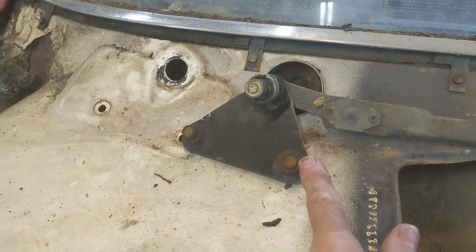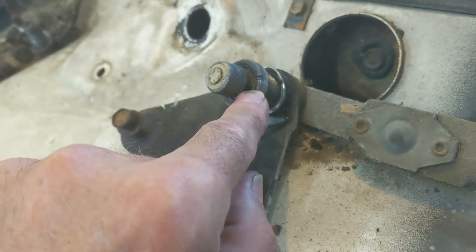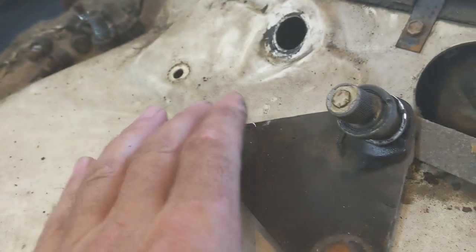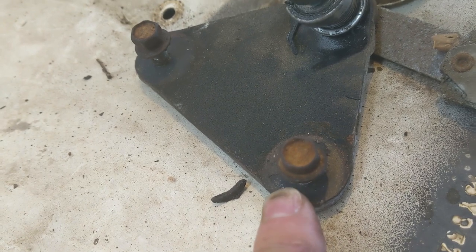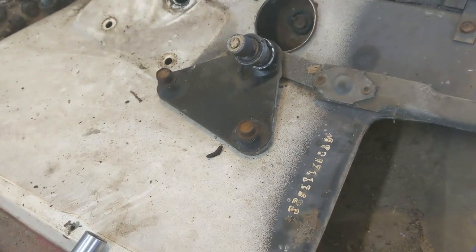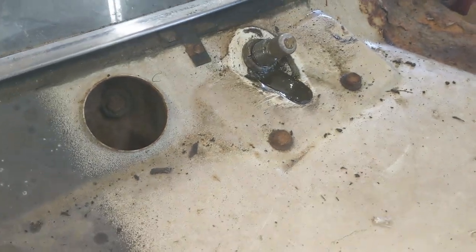There's the right arm off. So there's a chrome-plated or stainless ring — I'm not sure what it is, it's pretty dirty — and then there's the nut with the slots on it. There's no wrench provision on these. I had to put a little penetrating fluid — Deep Creep — on it. Then there were the two 7/16 bolts. Just a little tip: it felt like it wouldn't come out. I had to put the bolt back in and just tap down on it to pop it off. The other side will be very similar. I'm soaking out the left arm with some Deep Creep because that one was not cooperating quite as easily.